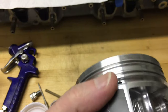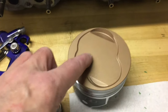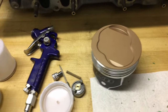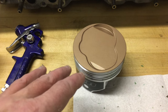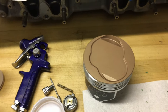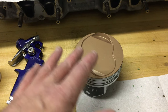I'm pretty pleased with the results. When I first sprayed it, I did three coats. The way I achieved this finish was not strictly just laying down paint from the gun. I masked off the pistons with blue painter's tape first — 3M type of stuff — and then shot the aluminum oxide to roughen up the surface of the piston.